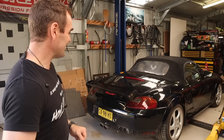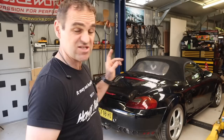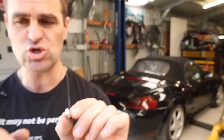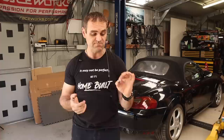There were a couple of things brought up from last time. Some of you might have seen that I made an olive for the power steering where basically the thread matches up the original Porsche side with the Audi power steering pump. They screw together but weren't sealing, so I made my own olive out of brass - and some of you suggested I do it out of aluminium, which I've actually done off camera. I've made another little olive - there was also talk it should have a taper on both ends, and it does, but it's a very flat taper on one end. That's because that's what the inside of the fitting already looks like, so I've tried to match it as close as I can. One side takes a proper cone-shaped taper, the other side is more of a very light taper.